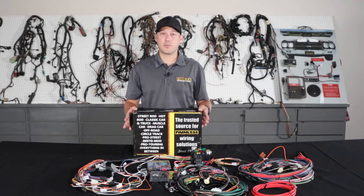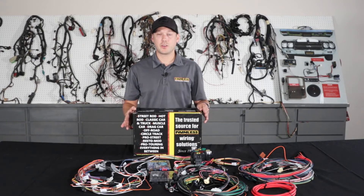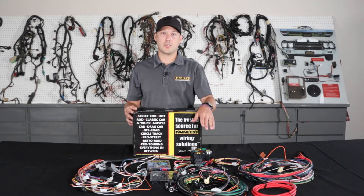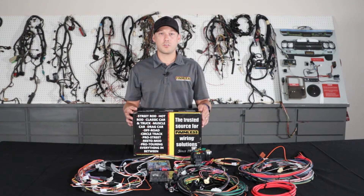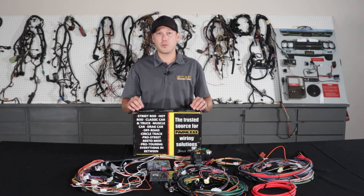While these harnesses are direct fit, they're not going to be an exact restoration harness — you're not going to find any glass fuses. It's going to have extra circuitry for modern amenities and all bladed fuses. They'll handle all the factory options, and a lot of the harnesses, like the 69 Chevelle, come with a console harness as well. So if you don't have a console and decide to add one, it's easy to plug in the harness later. These harnesses utilize all factory style connectors, and we also print on each wire. The installation manual covers everything you're going to need to know and makes it a really easy step-by-step process to put one of these harnesses in.